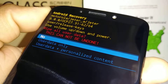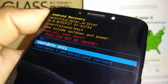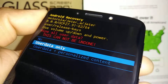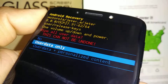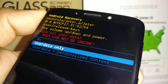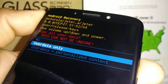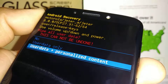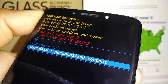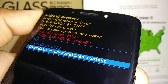Using Volume Down, you can choose 'User Data Only.' However, if your issue is that you forgot your password or PIN blocking the screen, this option won't remove those issues — it only wipes user data like web history and downloaded apps. The second option, 'User Data Plus,' is the one you want if you need to remove a forgotten lock screen.